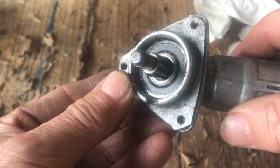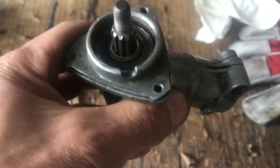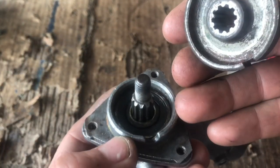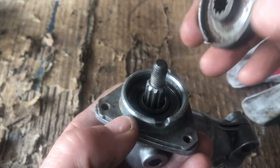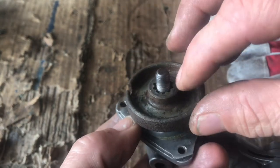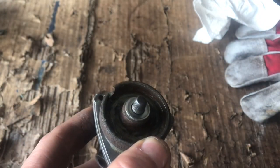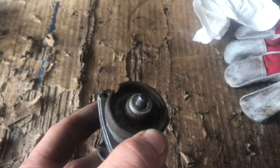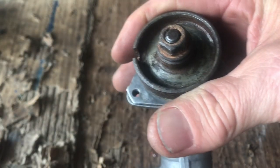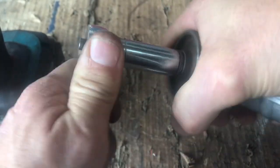So now we're going to go on to this one here. The circlip's out. To get that bearing out you can actually use what you've got. Put this on here — you can either put a socket on there and put a thread on there, or you can use this to get it started. Put it on that way and that'll start pulling it. Then you can use the nut just on there. Get yourself a few washers, put a few washers on there, find your nut, put that on. Now start that up, hold that in a vice if it starts turning. Can you hear it pulling? Just do it by hand. There you are — now it's locked solid.